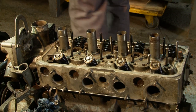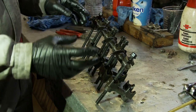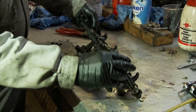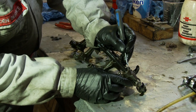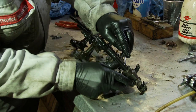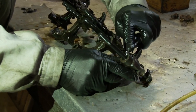There they are. Now the rocker shaft assembly — it's been in the wash tank for a quick clean and is in generally very good condition. I'm not going to dismantle it any further. But what we do need to change is the O-rings — there's a series of O-rings which have all gone hard over time. These are O-ring oil seals which go round each of the head bolts. And of course being awkward, it doesn't want to come out.